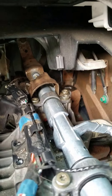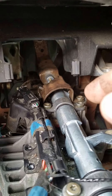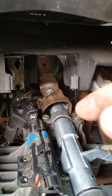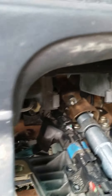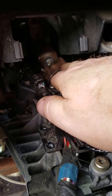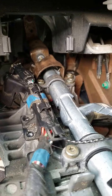The things you should probably know: at the end of this assembly, down at the bottom, there's a cable that goes to the transmission. It just pops off with pressure — you can take your hand and pull it off. I loosened up basically from the bottom upwards. There are three clamps. This lower one actually goes to a gear that goes to the tube, and that sets your shift position.